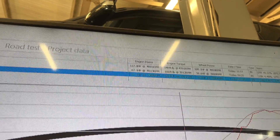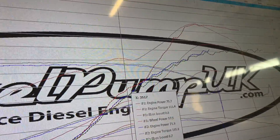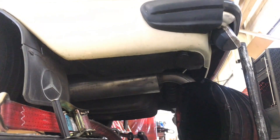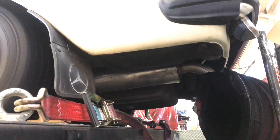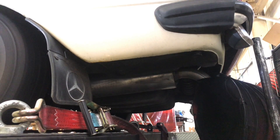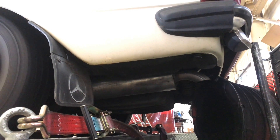That was a stone-cold engine. We went from 82 to 127 horsepower at the engine. Torque went from 108 to 148 — nice! Let's warm it up and do more. On the second run we're going to do a smoke check. We've got this pump set really low. Nice and clean — very nice.